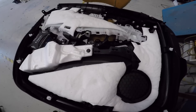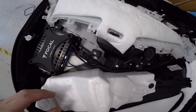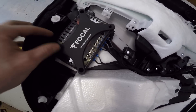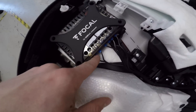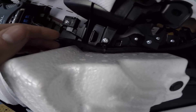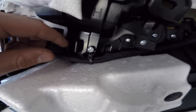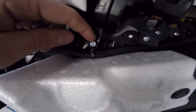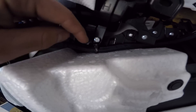Just interrupting the time-lapse for a minute — I want to show you guys how I did the doors in case I didn't show you close enough on the other one. The crossover is held on with one screw at this end going into the factory screw hole. There's a bunch of crimps so the wires aren't going to come out. Wire is all wrapped up in fabric tape so it looks nice and OEM. There's a cable tie here which has one of those screw holes in it, so the cable tie acts like a screw — goes through the cable tie and holds it into an OEM location.